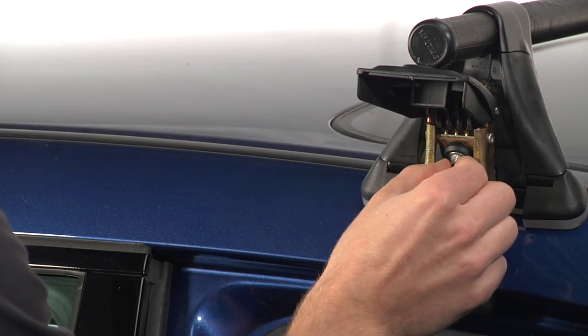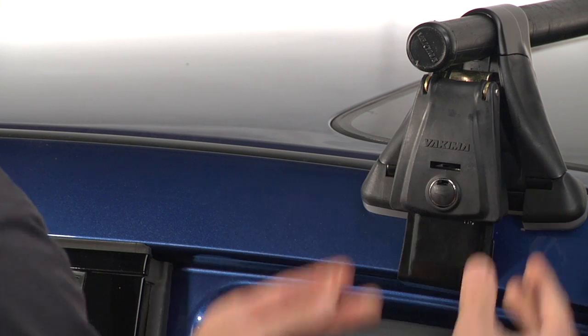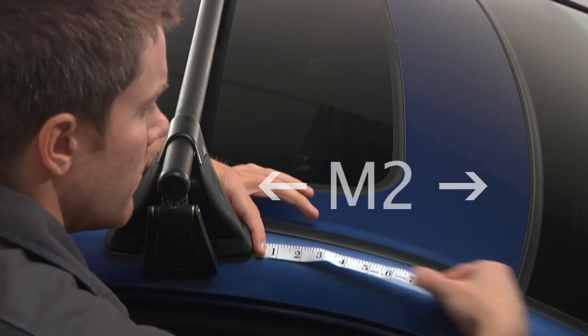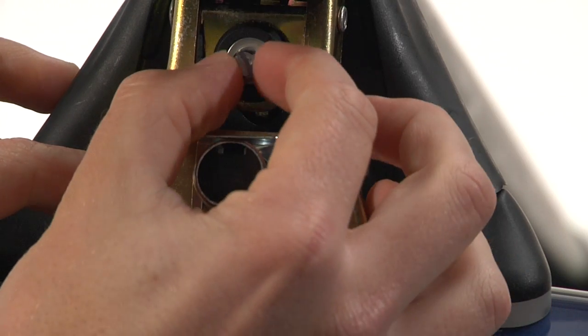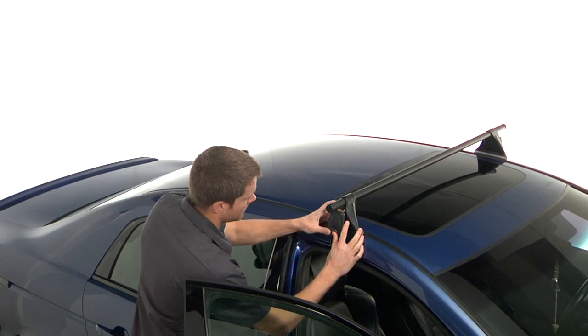From there, you can loosen the adjustment posts on each tower so there is little pressure when closing the cam lever. Be sure to double check your M2 measurements before tightening. Increase the tension on the adjustment knob using half turns. Adjust one side at a time and close the cam cover after each increase in tension.